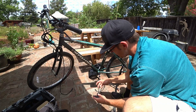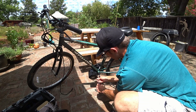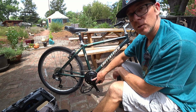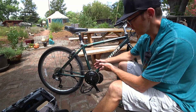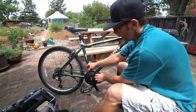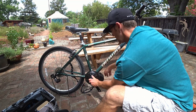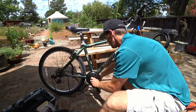I know I'll be putting this on another bike pretty soon, so I'm just going to put the fasteners back in loosely. I could take the crank arm off and take the bolts off the chain ring, but I don't really need to because it's just going to slide out, and I know I'm going to put it on another bike so I don't need to do that. I'm going to slide the chain off out of the way and this guy should just come right towards me.